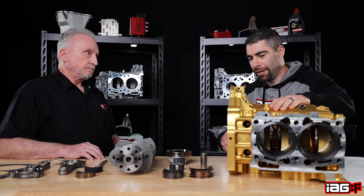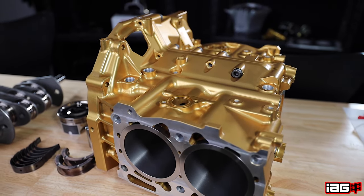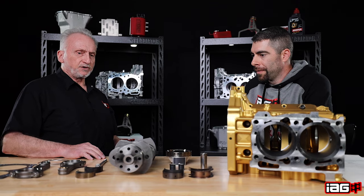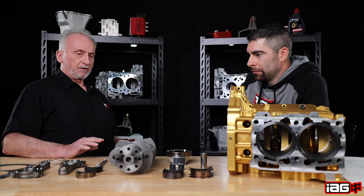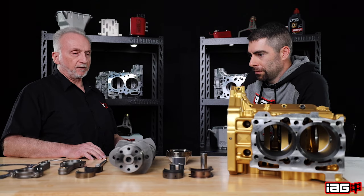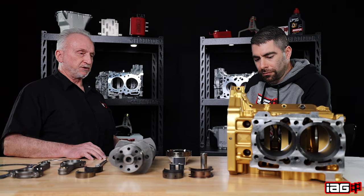What are obviously the cases — a major difference — but what else are we looking at that's different here? As far as the internal parts, those parts are identical to the Stage 4 Extreme: the billet crankshaft, ARP case bolts, the I-beam rod, 625 bolts, a 927 diameter pin, and the matching pin and piston to go with that.